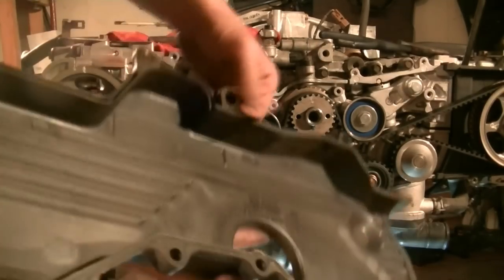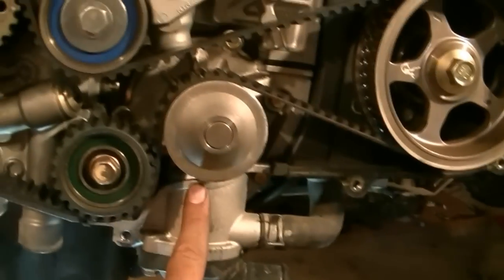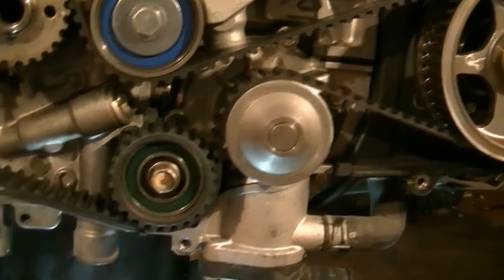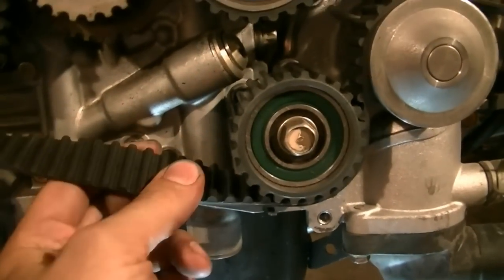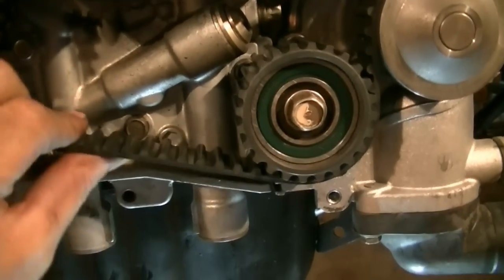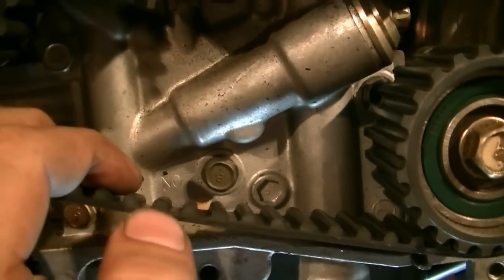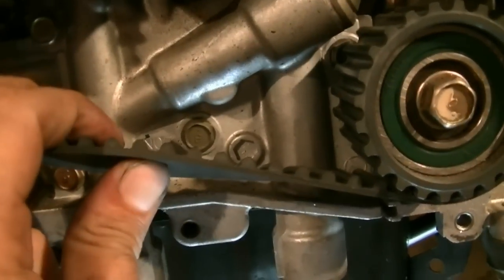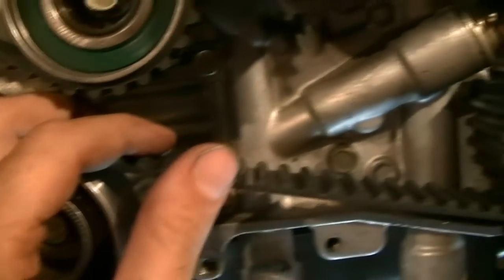It's actually going to be hard to lose, just don't forget to press it all back in place before you reinstall this. With the timing belt cover off, we have a closer look at all our timing components — they all look in near new condition. The hydraulic tensioner looks new, all the rollers look in really good shape, the water pump looks good. It looks like not too long ago there was a timing belt service done. To inspect the timing belt, take it off and inspect it closely — bend it and inspect inside all the ridges. Another way is to look at the top of the ridges; they should be round. If they've started to deform and aren't as perfectly round as they should be, that means it's getting worn and it's time to replace it.